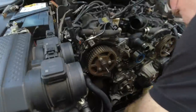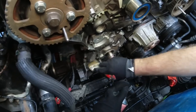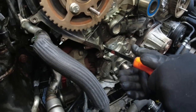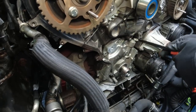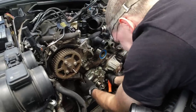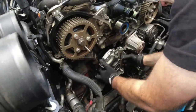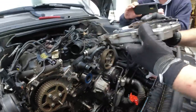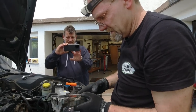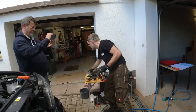Now the car can come back down. I'm cleaning the area around the oil pump. Now it's moving — and here too. There's your oil pump. This one is worn out because the car had low oil pressure. Now we install a brand new one and hope it has increased oil pressure. If it doesn't, the engine is worn out. It's AB — and it's from 2012.